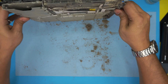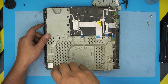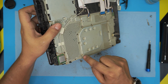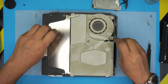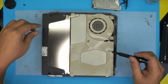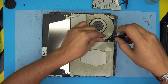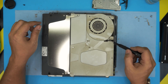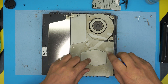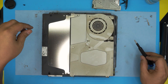Now, before we flip it over, we're gonna remove the screw in the second corner — that holds the power unit. There's also a long screw coming from the other end. Remove the Phillips screw down at the back, and the hidden screw under the dust. Remove all the Phillips screws on the sheet — on some models these come as plastic patch clips instead of screws, but some models give you screws. Remove all the Phillips screws on the top cover.